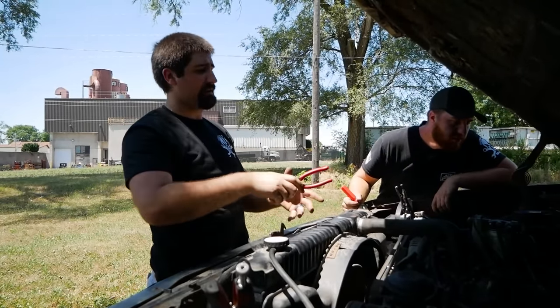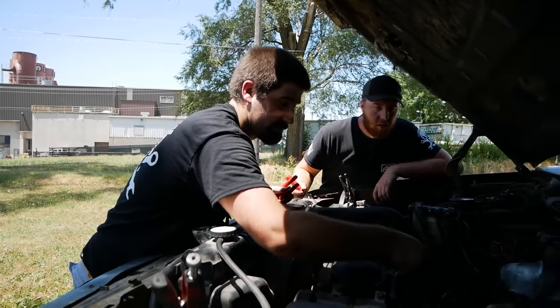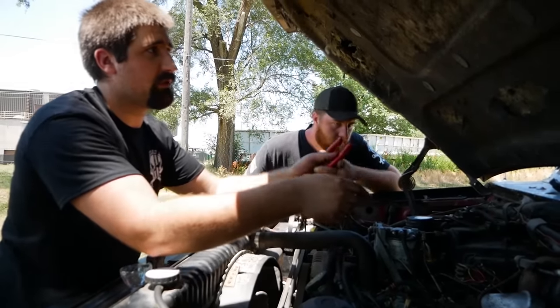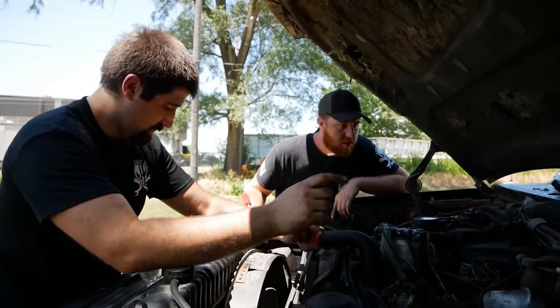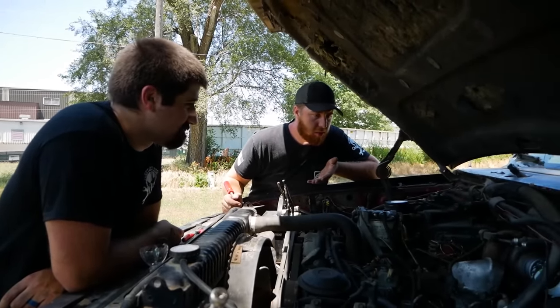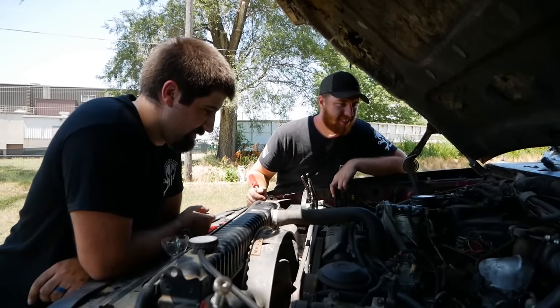So we'll whip it over, blow some of the crap out of the way. I've got the key on, so the pump here is powered. It'll be pumping fuel. And if we start getting fuel while he's cranking it, we'll see little spurts of almost grayish white smoke coming up, and that's a sign that we've got fuel to the cylinders. Should go real fast now that there's no glow plugs in there, as long as it didn't melt together after the fiasco the other day.